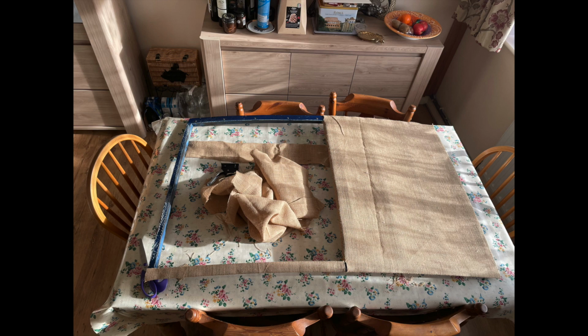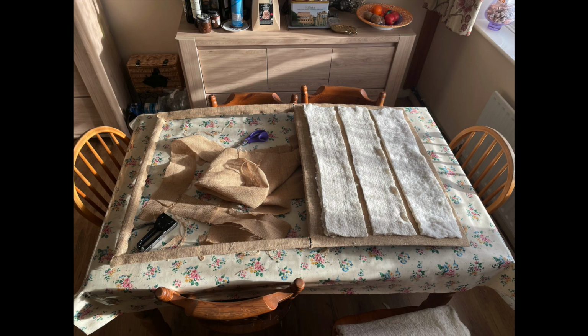So then, back indoors, and we've finished covering the hessian over the very back section there, and pinned it all in underneath. We're now also, as you can see, covering the sidebars going from above the passenger and above the driver's heads on the left and right of the car. We're covering them in hessian too. The reason for using the hessian is that when we cover this with the fabric eventually, this will help give it a smooth edge over that metal strip, and should help us get it looking quite nice.